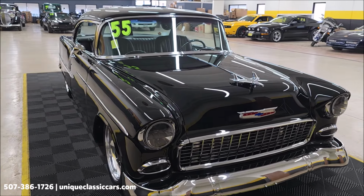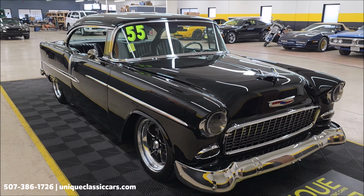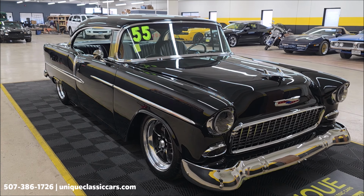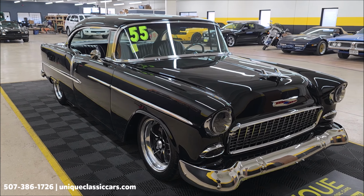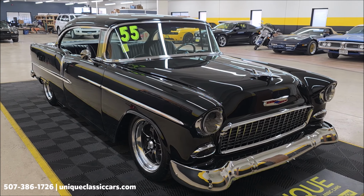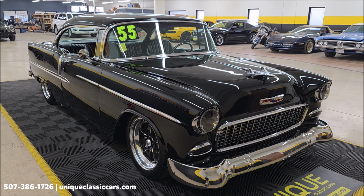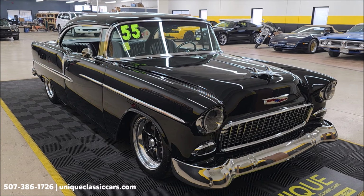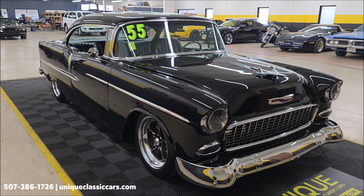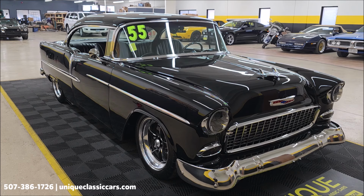All right, so I mentioned the 430 cubic inch dry sump LS7 underneath the hood. How about a little something about that engine? It does have stock LS7 crank, Wiseco forged pistons, factory TI connecting rods, SpeedTech Performance oil pan, remote mounted oil filter, LME CNC ported heads with TI valves, BTR dual spring kit, TI retainers. Also has an RPM B3 camshaft, a Holley fuel injection system, throttle body.